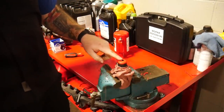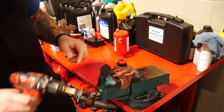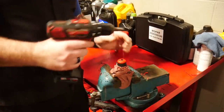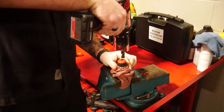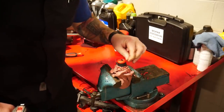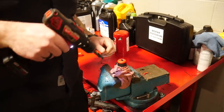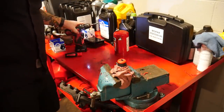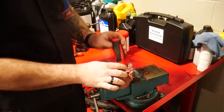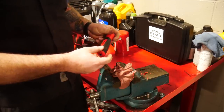We've got it flipped over, and here on the backside where the bit came through, we're going to do just a little bit of a bevel using a bigger bit with a 135-degree angle — just a slight bevel so it kind of angles down into what we really wanted. Now we're going to get our tube and start working with it to see what kind of angles I'd like for it.